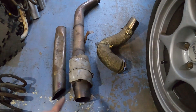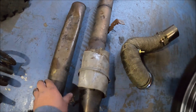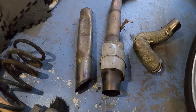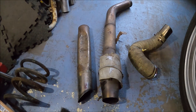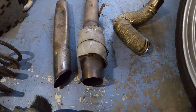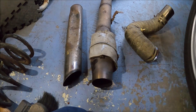Originally it had this side pipe on it — it's home-squashed, goes wider there, I won't call that a restriction. It looks a bit rough but you can't see it under the car, and it looks pretty badass with that tailpipe. Just because I wanted to, as I explained in a previous video, I fitted this race cat I had kicking around — it's a metal high-flow 100-cell race cat to the tailpipe, because of flames and because I wanted to see what it was like.